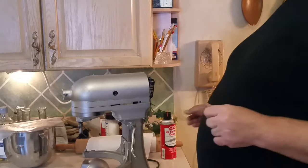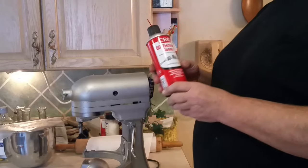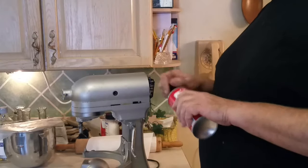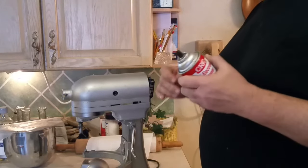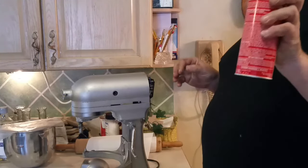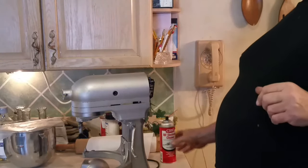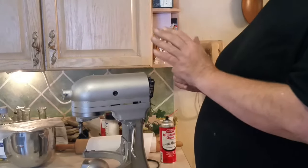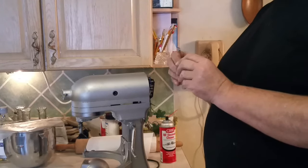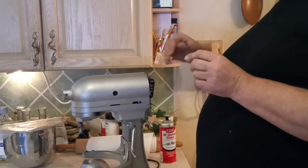The other thing you can do to make your motor run cleaner and a little bit more efficiently — I recommend this for all electric motors — is QD Electronic Spray Cleaner and Degreaser. Shake it up, insert a little straw into the tip for a controlled spray, and give it one little blast of QD Cleaner in there. What that will do is coat the armature, picking up all the debris and dirt from the carbon brush wearing down over the years, and let it fall off inside.